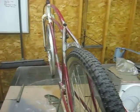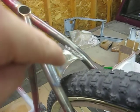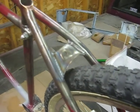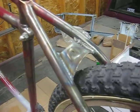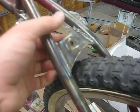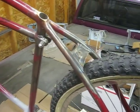I did forget to mention that the fender bridge was crushed. It was a tubular fender bridge right here that went across. Somebody had tightened the fender in too tight on that tubular bridge and crushed the center of the bridge section down, basically ruining it. So I cut that section out and replaced it with this fender arch brake plate piece off an 80s Huffy Cruiser. This is kind of nice because now with the brake bridge, you can put a brake caliper on there and run a three-speed hub if wanted, or just leave it without a brake and run the fender on there.